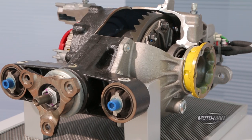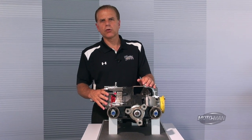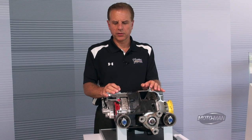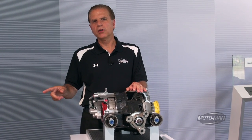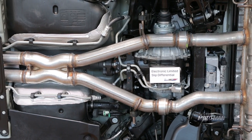One of the magical devices that gives this car precise steering response, stability, and the ability to exit corners at maximum speed is what we call our ELSD — Electronic Limited Slip Rear Differential. It's a standard differential but with an electronically controlled clutch pack. We can go from zero preload to 2,000 Newton-meters of preload, which allows us to transfer torque to the tire that can give maximum acceleration. Unlike brake-bias torque vectoring that some competitors use — where braking actually slows you down — with this approach you enable acceleration by transferring torque to the tire most capable of handling it, allowing you to exit turns faster. It also has its own unique cooling system that feeds back up into the trans-oil cooler up front, keeping it cool during all driving maneuvers.